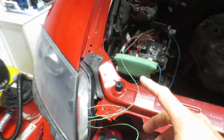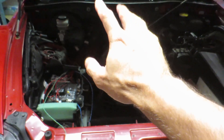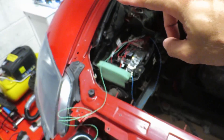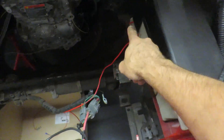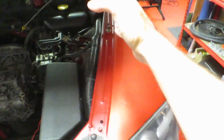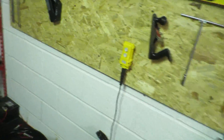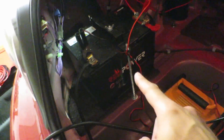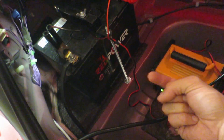A few updates up here — CAN bus wire. I've got that to link my Arduino to the BMS, which is going to be in the boot. That's wired and going down the side where all the wires go in the RX-8, all nicely wired in with about all the interior out to do that. I've also got a new 12-volt low voltage cable going through this side of the car down into the boot, because I've moved the 12-volt cabling for the car into the boot. So this is the new position for the battery. I've got an M8 bolt here through the chassis, welded a nut on the other end so it can't fall off — super solid, not going anywhere. That's where it's going to live and it's all working beautifully.